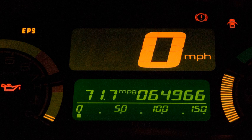A computer converts the pulses to a speed and displays this speed on an electronically controlled, analog-style needle or a digital display. Pulse information is also used for a variety of other purposes by the vehicle control system, e.g. triggering ABS or traction control, calculating average trip speed, or to increment the odometer in place of it being turned directly by the speedometer cable. Another early form of electronic speedometer relies upon the interaction between a precision watch mechanism and a mechanical pulsator driven by the car's wheel or transmission. The watch mechanism endeavors to push the speedometer pointer toward zero, while the vehicle-driven pulsator tries to push it toward infinity. The position of the speedometer pointer reflects the relative magnitudes of the outputs of the two mechanisms.